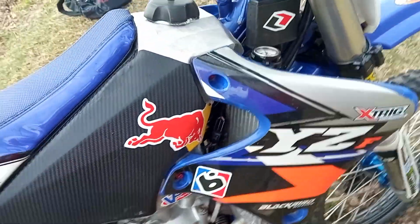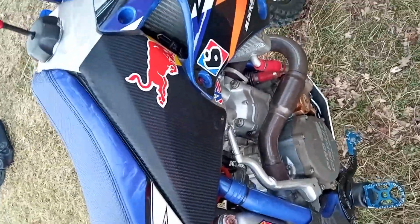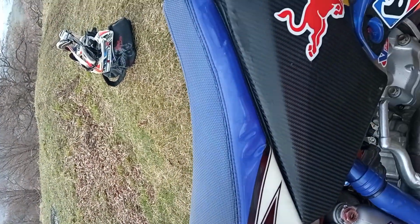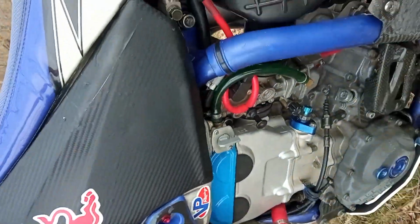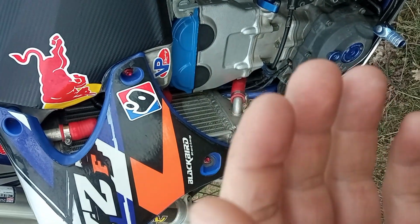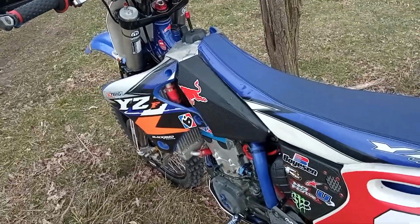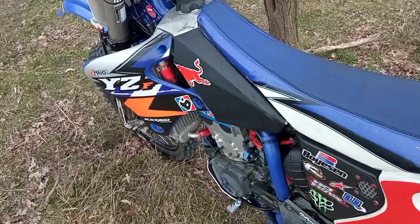Also the bike, I've changed in 2010 the gas tank. It was the original one with the plastic, but I broke it, and from what I saw on the internet, many had this problem with the tank. Under the seat, where it connects to the seat and the frame, it develops a crack, and no matter how you try to seal it, I've tried with RTV, with silicones, with all kinds of stuff. I've even taken the tank to a friend that melted the plastic from the sides and filled the hole. From what I saw, that was the single method that managed to stay intact somewhere about 2 months. After 2 months it cracked again.